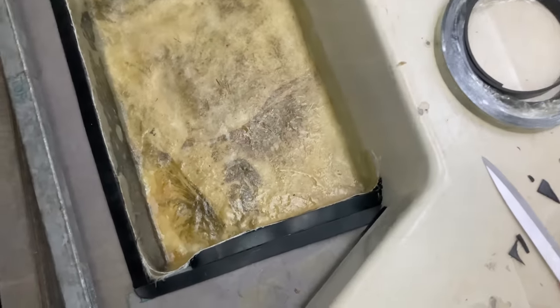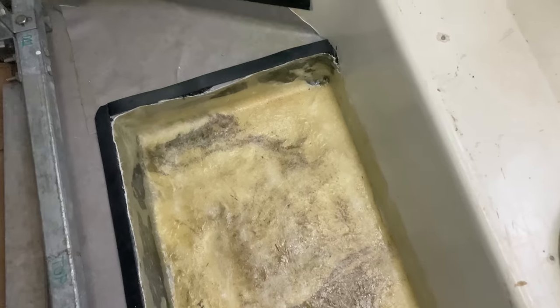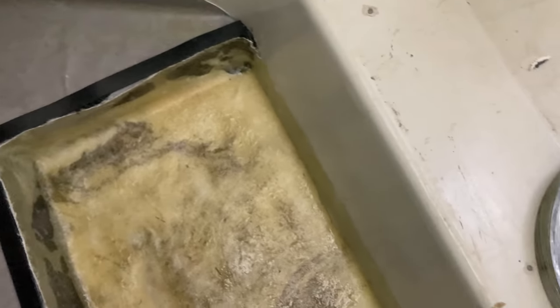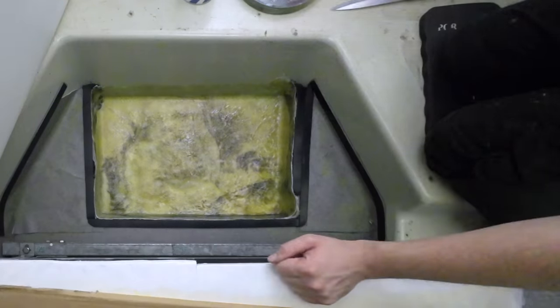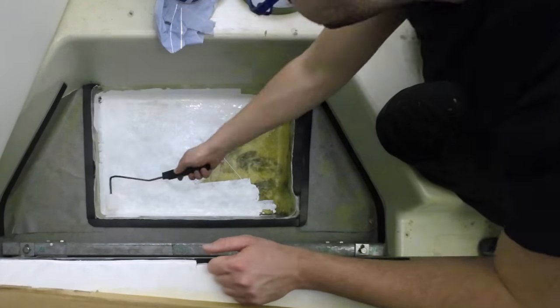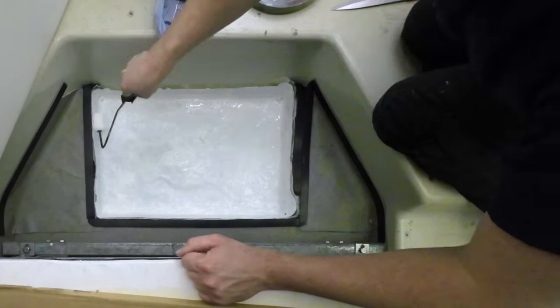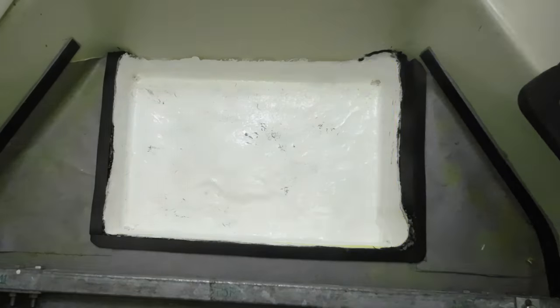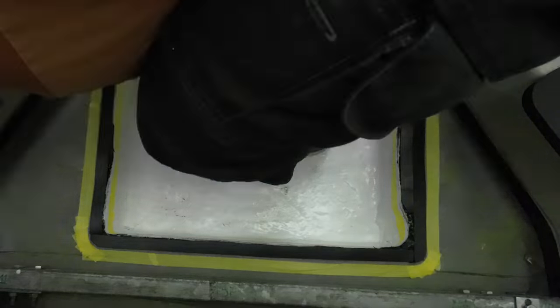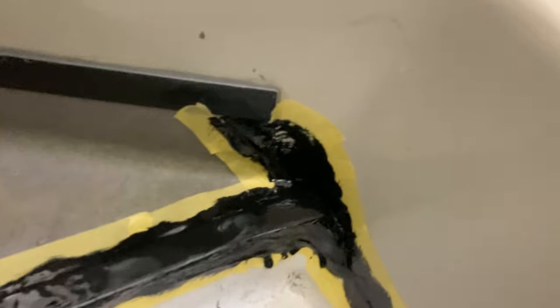Let's interlude from the mounting of said plastic for a moment or three, and finish off the floor recess. The glass fibre is nearly transparent, so all the mucky foam still shows through. Also, I've edged the top with some basic rubber strip. And now, lots of fun with my go-to cheap and cheerful white bilge paint. It's tough, wipes clean easily, and covers a large surface area quickly. The rubber edging wasn't sealed, so I'm finishing off with a layer of my new favourite product, the air-curing liquid rubber coating from Gorilla. Not bad, although that edging tape, like before, still doesn't do a great job with this viscous rubbery liquid when it comes to sharp lines.